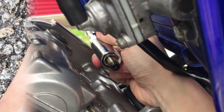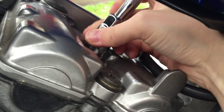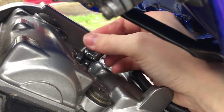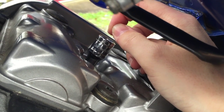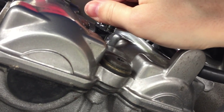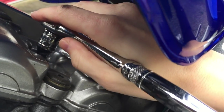I'm happy to pop those back in. Remember when screwing it back in that we're going into aluminium, so don't drop this end where the gap was measured, and start it by hand. You can feel if the thread isn't going in as it should. Tighten until hand tight, then if it's a new spark plug do half a turn — put a permanent marker mark on the socket and twist until you see it. Where it's a plug that's already been used, a quarter turn is sufficient.